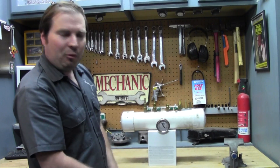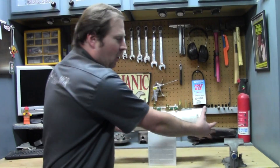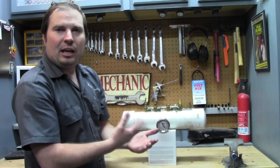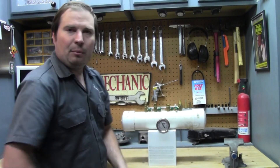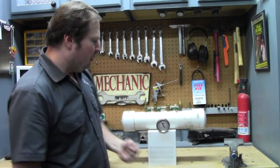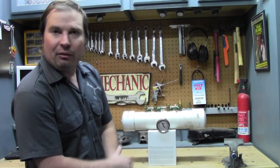I built this for probably about $20. This is actually a fluid-filled gauge, which helps dampen the intake pulses. That's also why you have this big of a plenum — because there are a lot of intake pulses in a motorcycle engine versus a car engine when you hook a vacuum gauge up to the intake manifold. You have a big volume you're taking a vacuum reading from, versus the individual ports on the intake, which have very little volume considering the hose and everything here.